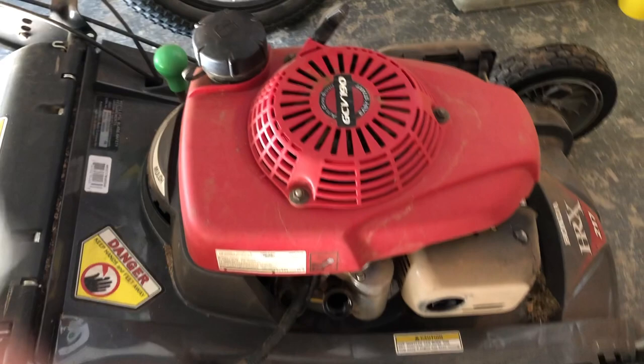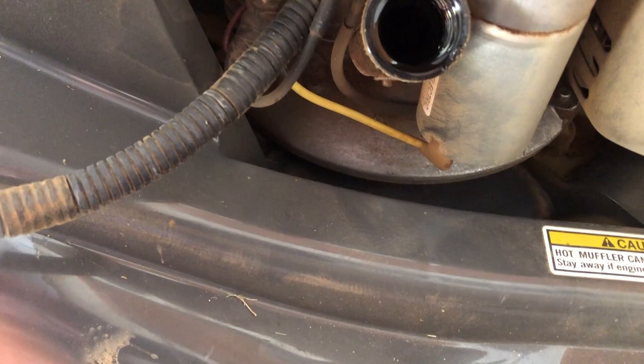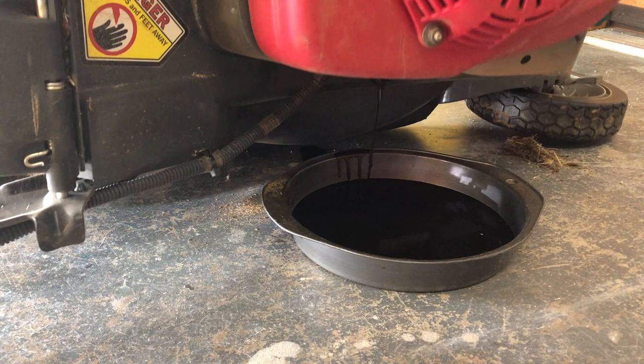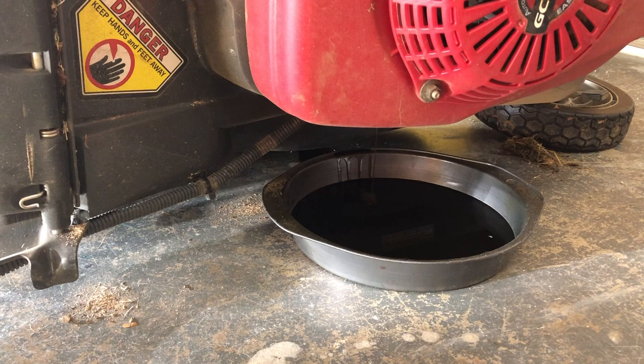This is where the oil goes — that's the dipstick. To drain the oil out of this engine, you just have to tilt it onto its side. I have a nice low profile cookie sheet for that, but I misplaced it, so I'm gonna use this cake pan. I can always wipe up anything that I spill — no biggie. We're gonna let this drain for a while.